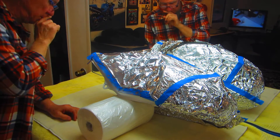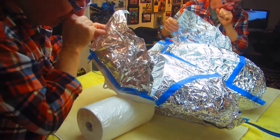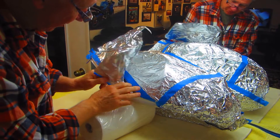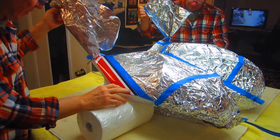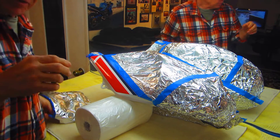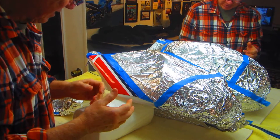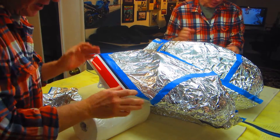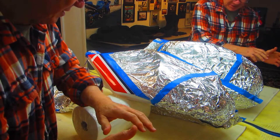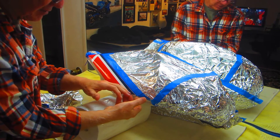I'm just wondering where I'm going to put the cut line on this. The clear has been drying actually two days now, more than 24 hours — it's perfectly hard, so we can sand it. The thing I always try to explain to people learning to paint: this paint is dry to the touch in an hour, sometimes two hours depending on the temperature, sometimes overnight. But if you let every coat of paint dry overnight, you really stack the deck in your favor that you're not going to have an issue where paint underneath is still wanting to dry.